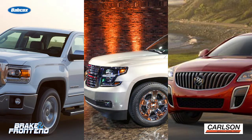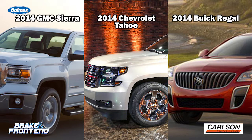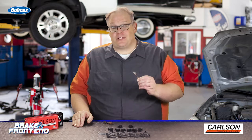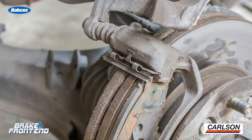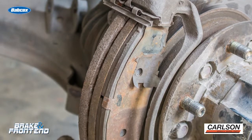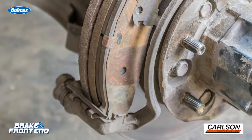In a recent laboratory study, three vehicles were tested for their first brake job. The mileages on these brake jobs varied between 35,000 and 45,000 miles. When they took the original hardware off and looked at it, they found the dimensions were not the same as when it went on new. The shape had changed and the spring tension had changed too, so the hardware could not hold the pad properly in the bracket.